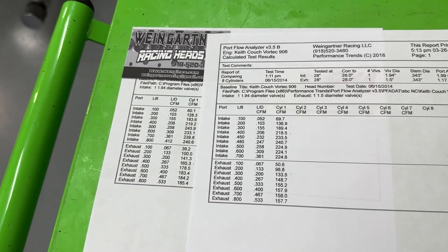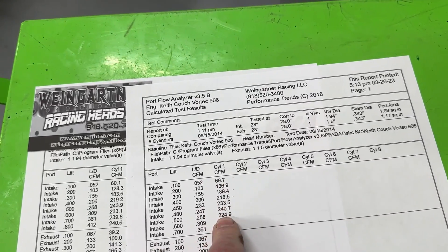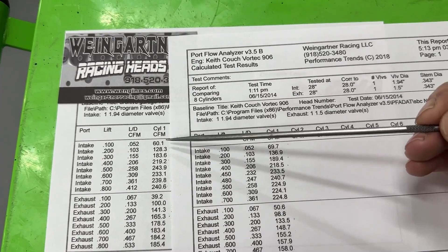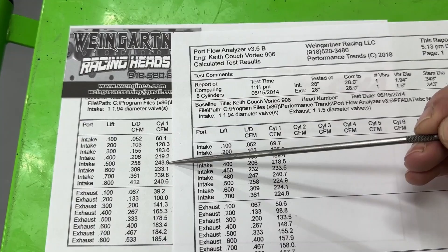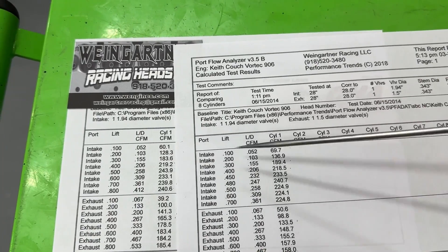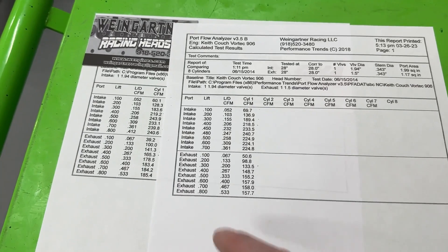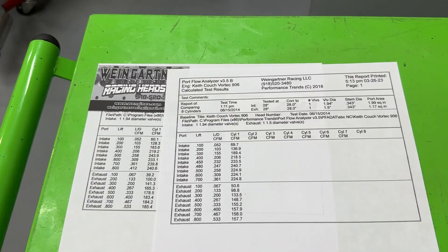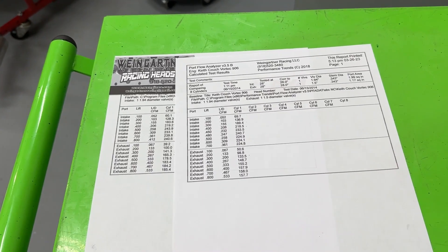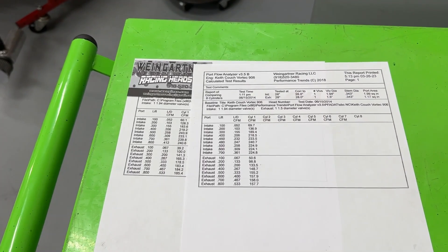Don't feel discouraged — you did a great job grinding. If I had mixed in a valve job with your work, these numbers would have been better across the board on the intake, and even better on the exhaust. From the mid-lift range on you would have beaten the valve-job-only head and matched or exceeded it everywhere. Hopefully this helps anyone grinding on 906 Vortec heads. Thanks for watching, and thanks for sending this in — hopefully I wasn't too harsh. You did a really good job on cast iron because it's a passion. Take care, guys.